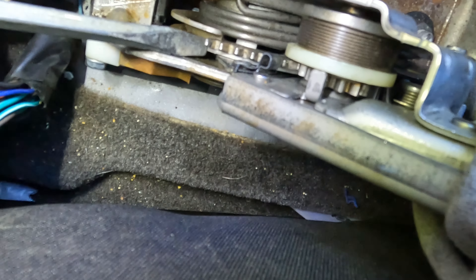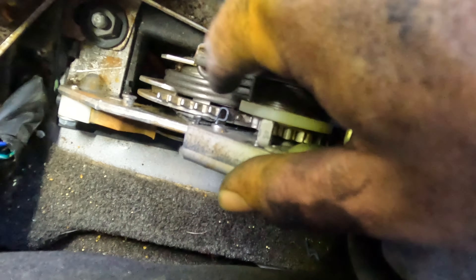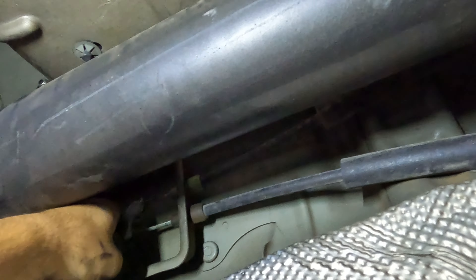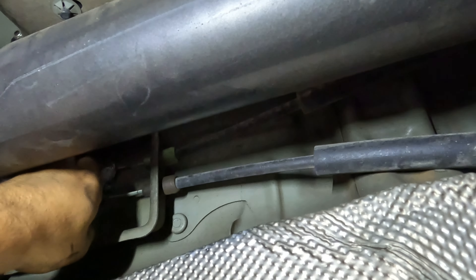I had to do that just to get slack back here. I tried pulling it with pliers on this side but there's not much room. I pulled it forward and was able to muscle these into the bracket again. I bent this side back to where it was when I initially pulled it. So now I'm just going to adjust the e-brake, put the disc back on, and then let this tension go. Let me go up there and release the tension — hopefully I don't bust another knuckle — and then that'll tighten this up.